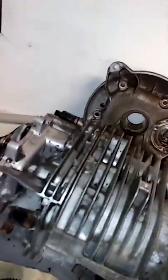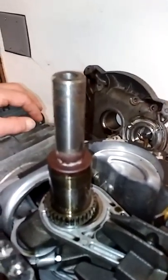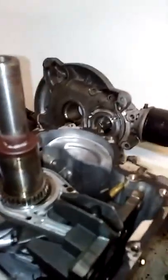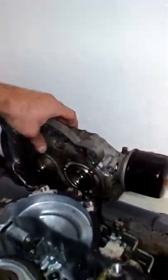The compression relief is working, so we're good there. The long and short of it is the bouncing around and hitting all them stumps — the valves just got loose and came off, so no compression. It was just blowing back through the motor. That's why it wouldn't crank — that's what was wrong with it.